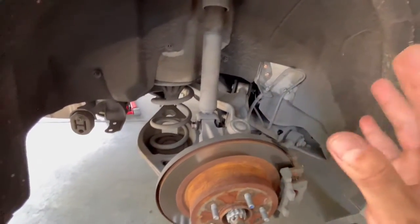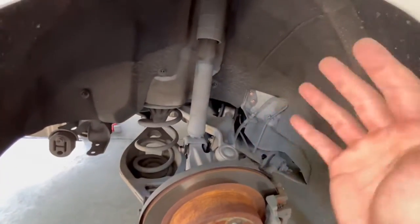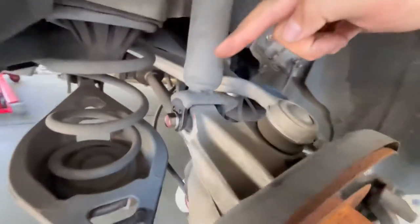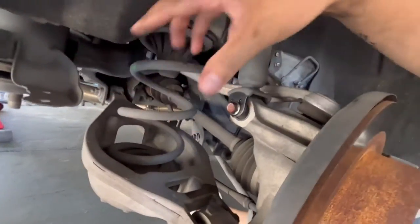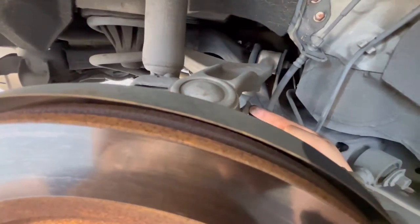This is why I love working on rear-wheel drive cars. I haven't worked on an all-wheel drive yet, but compared to front-wheel drive, rear-wheel drive is a major difference. This is a multi-link suspension. We've got two bolts on top — one right there and one back there — then we come down here and loosen this bolt, loosen this bolt to release the spring bucket, and then the strut comes out. We might have to release the end link as well.